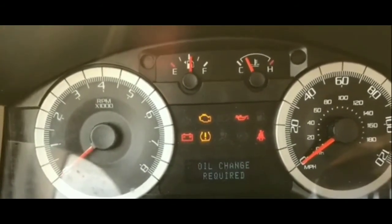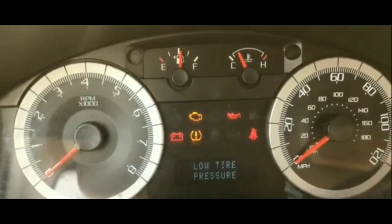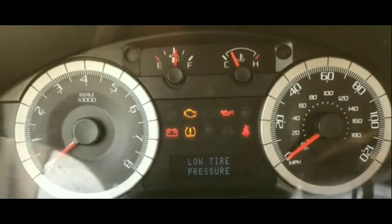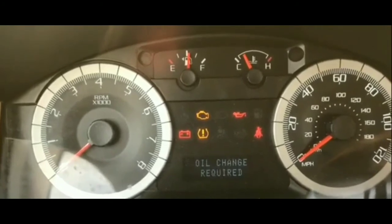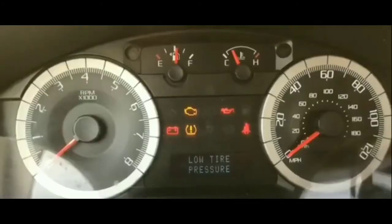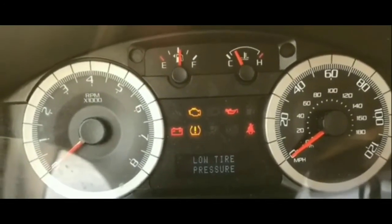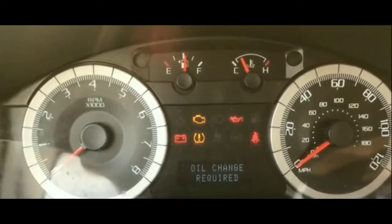However, that erodes over time, and when you turn it, I believe there's just enough space for there not to be contact, so it doesn't actually turn the car on. Now I don't have that to show you right now, but if you have this problem, it's probably your ignition module that you need to change. I've been able to drive like this just to get the car started since, and I haven't had the time to change out the module.